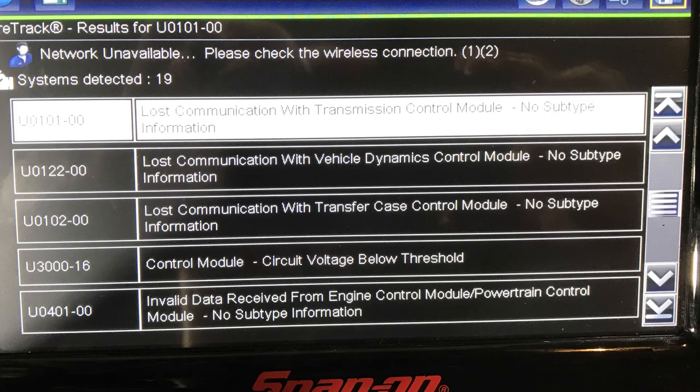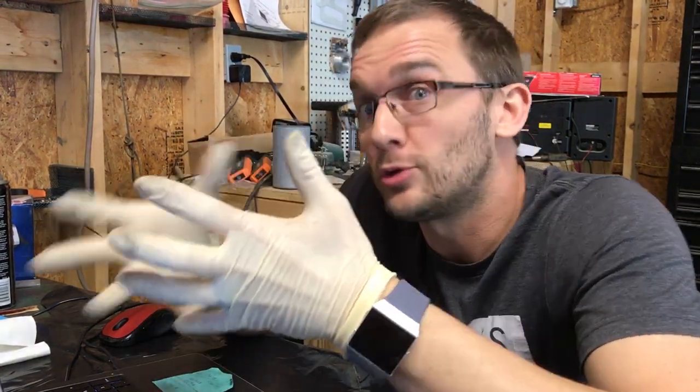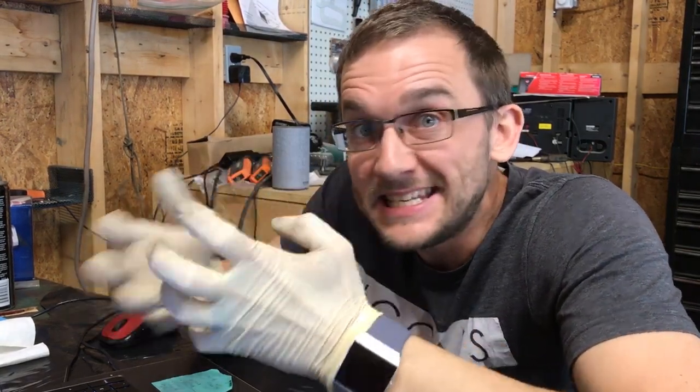Whenever you see a loss of communication or a low voltage code, those are a lot of times stored even though it's a resolved issue. The modules lost communication at some point and now they're back — hopefully. Here's a really interesting one that could still come back and bite me: the occupant classification system crash event storage, full and locked deactivated. The restraint control module: crash events stored, driver's seat pretensioner. Sometimes when an airbag deploys, the supplemental restraint module — the thing that controls your airbags — some of those modules are only designed to be used once. Once a crash has occurred, they'll brick the module and it can never be installed in another car again. I'm a little concerned because I don't know what those modules cost, but I'm sure it's expensive, and you'll absolutely have to have it programmed and calibrated.